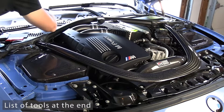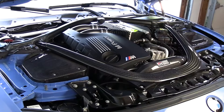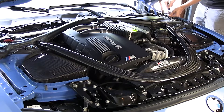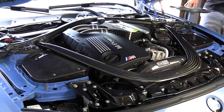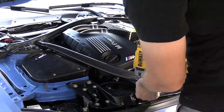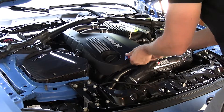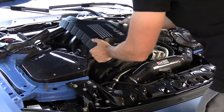For most things we need to do before getting to anything in the engine bay, we have to remove the black shrouds in the back and the brace. For the black shrouds: first a 10mm, quarter turn on the six bolts in the back, then a pry tool to get the plastic clasp up on the sides. Then it's a 13mm to remove all the bolts around the brace, a 10mm for the bolt attaching the brace to the coolant reservoir, and for the engine cover just pull at the corners — they're secured by rubber grommets.